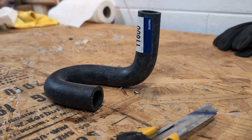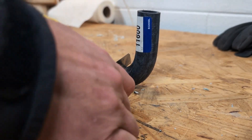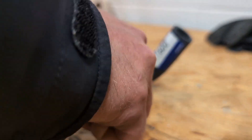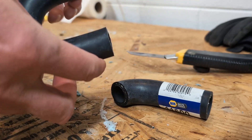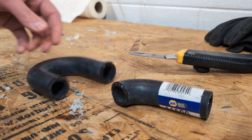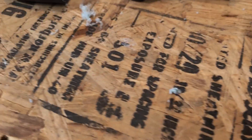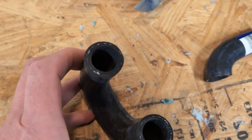Find yourself a piece of coolant hose that's preformed with a 180 degree bend. Make sure that both ends are 3/4 inch inside diameter. With this particular part, I had a 180 degree bend and a 90 degree bend, so I'm just using a razor blade to cut off the 90 degree portion to leave me with this U-shaped 180 degree bend. I'll include links to this part and at least one other option in the description for this video.